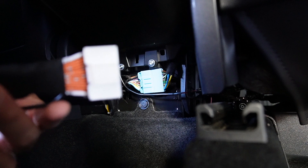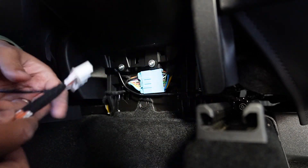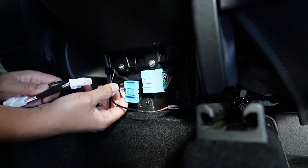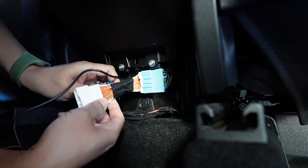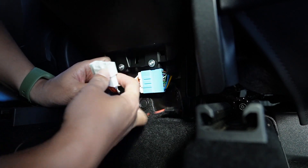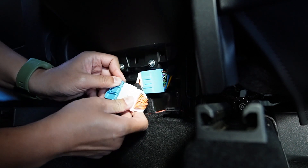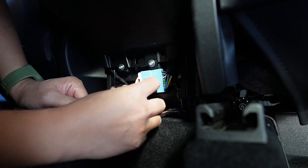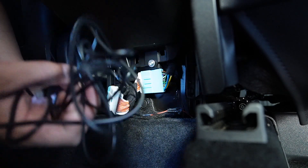Now you can unplug the OBD port. Now that the power is off, we are going to use this wire harness that came with the display. This is the pass-through wire harness — we'll get the data and power from here. So you basically unplug the blue plug, and then plug in the plug that's from the Temu display, twist a little, and then plug the car plug back into the Temu plug. This way it will pass through all the information from the car that the display needs through this wire harness. Now we just have to run this wire to the front.